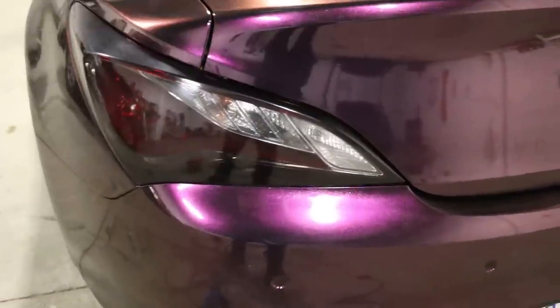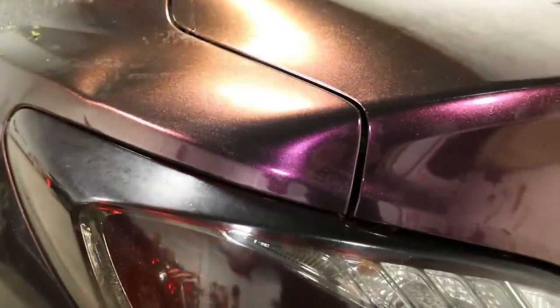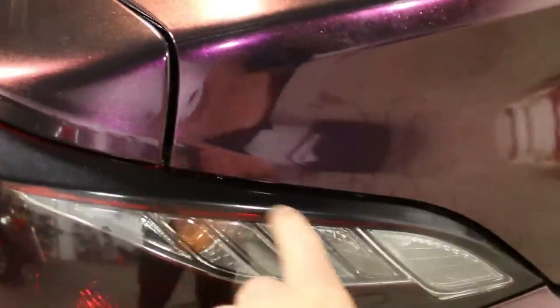As we can see, there's no lifting around the reverse light area, and there's no lifting around any of the edges. That's just cut straight off at the bottom. These are not the easiest lights to tint simply because of the taper at the top — we get into a nice compound curve, same thing around here. I do have videos on tinting these specifically.